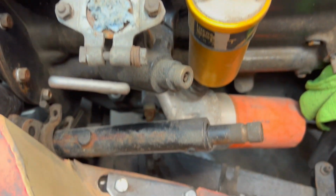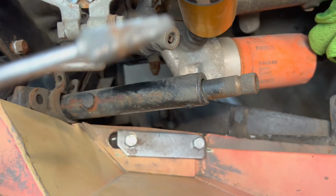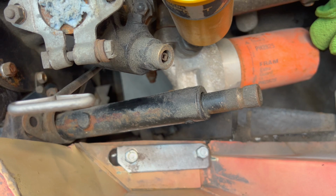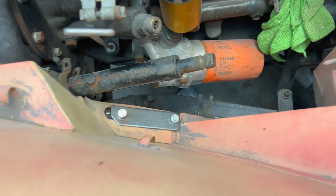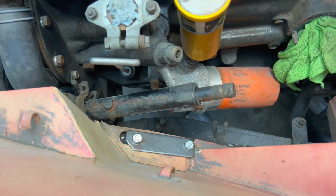All right, we did a little surgery here to make this fastener location line up. We used a little rotary tool, a raspy thing, and cut some slots and managed to get that plate to line up, at least temporarily. We can always weld the slots closed later if this works out okay. Anyway, it's tight now. All of the locations in the car have been done with the exception of the two at the rear. Like I said, we're going to go back now and pull all the packing pieces in and tighten those down solidly. Now that we have this location figured out, temporarily at least, we can go ahead and do that now.